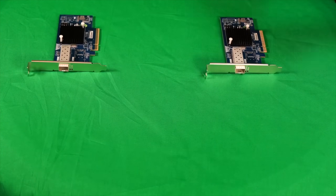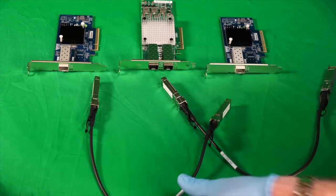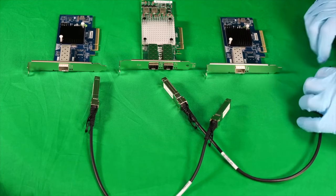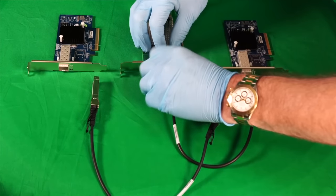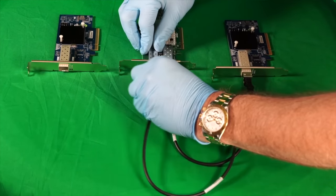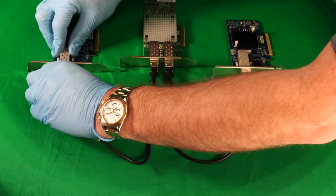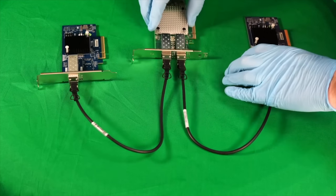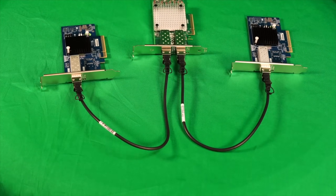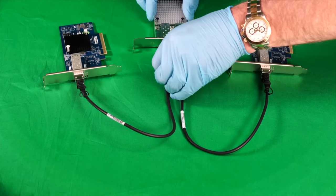What if you wanted to connect three PCs? You're probably thinking it's time for a switch — but not necessarily. With simply two cables, as long as one of them is a dual-port card, you can through software routing wire them together. If your situation gets any more complicated than that, however, you pretty much have to resort to using a switch.